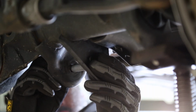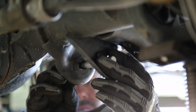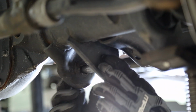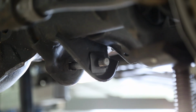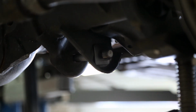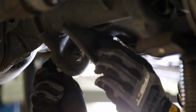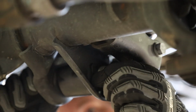After marking and grinding away the material necessary to push the mounting bolts back towards the rear, which effectively lengthens the distance from the axle to the frame mounts for the control arms, the cam locks were test fitted to the mounts, and then the control arms were reattached and torqued to the required 207 foot-pounds. It is this latter torque spec that led me towards professional help, as it could be difficult to generate that kind of torque when you're laying on your back with the Jeep on jack stands.